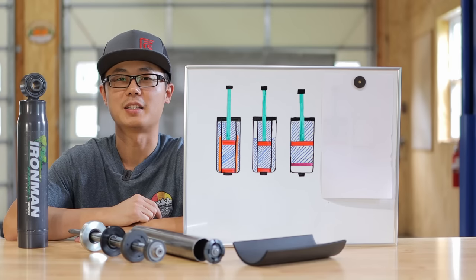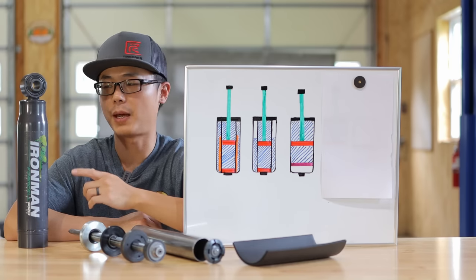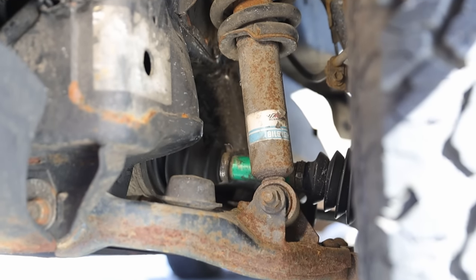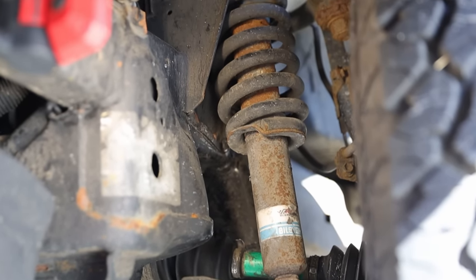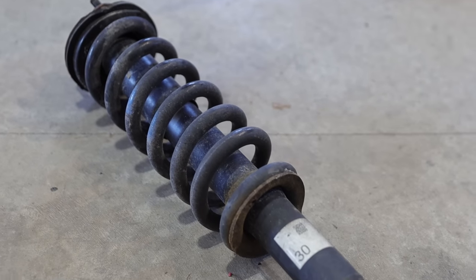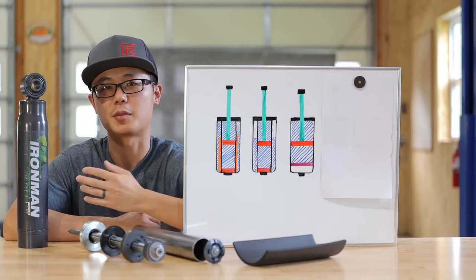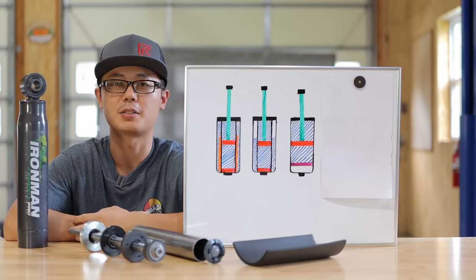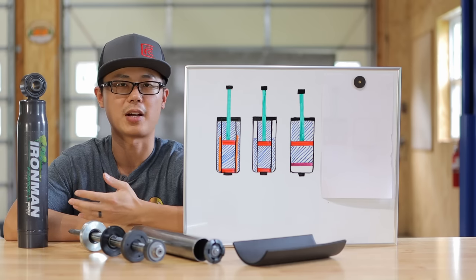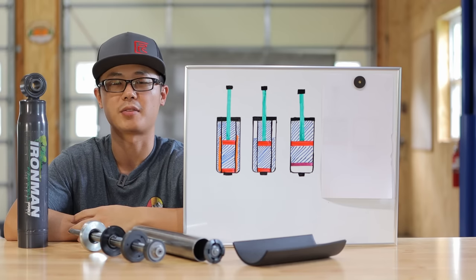Being a Northeast guy, rust is my biggest pain in the winter. A good quality painted shock body usually outlasts a zinc-plated shock body. Here is my Bilstein 5100s installed on my first-gen Tacoma — this is how the shock body looks after 4-5 winters. In comparison, this is a factory coilover from the 2013 GX460, with very little rust after 9 winters in the same area. This makes sense because zinc is a sacrificial layer — it's only a matter of time until all the zinc plating is eaten away. Whereas paint, or e-coating in the case of Ironman, is a protective coating that lasts longer in a highly corrosive environment.